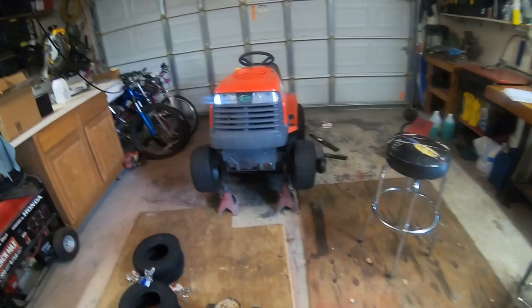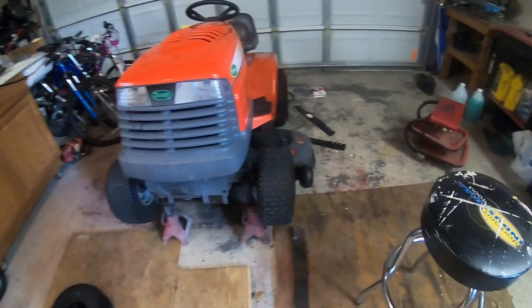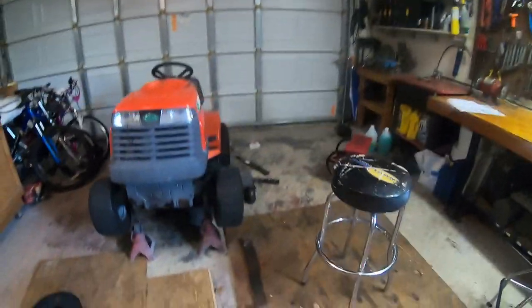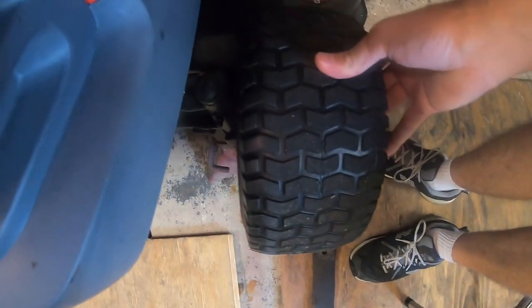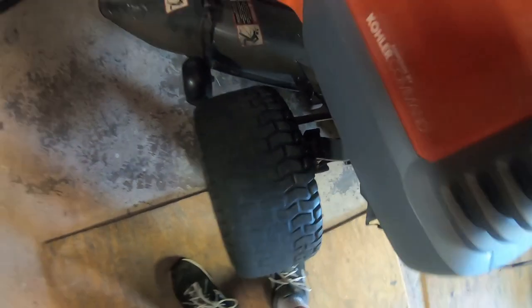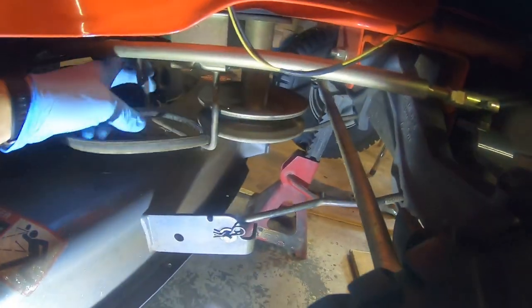I got the front of the mower up on jack stands using an automotive floor jack — that gives us a little more room to work. You can see visually that one wheel is a little off-camber compared to the other one. Looking at the spindles, there's a bit of play in one of them — and a lot more in this other one. I suspect the bushing is worn on that wheel, which is one of the reasons we're changing it. To tackle the deck belt first, I'll just slip the belt off the crank pulley and see how the belt is routed.